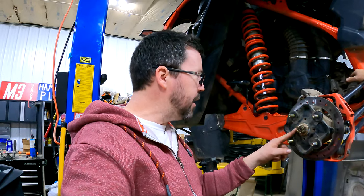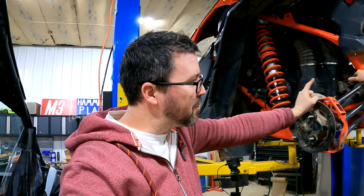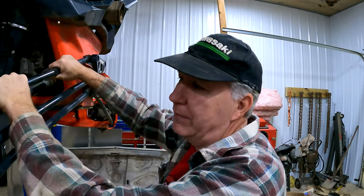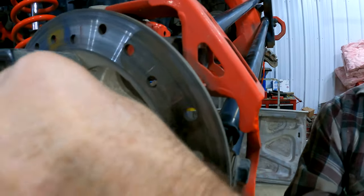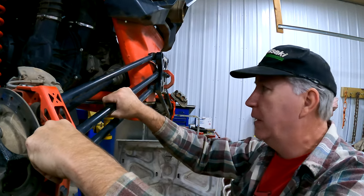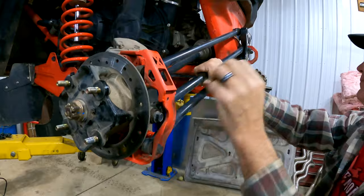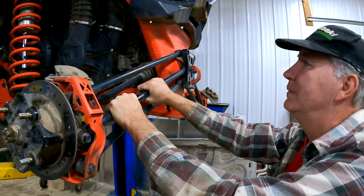The next video we'll tear the front end off completely — replace the bushings, do the brakes front and back, replace the retaining clip, and possibly replace the passenger side radius rod. They all have the same bushing in them. You can get the Shock Therapy double-shear setup, but that's not really our problem here. The issue is the rubber mount on the ball joint itself. So if you're looking for clunks and bangs it's going to be up in your front end most likely with the bushings.